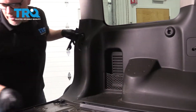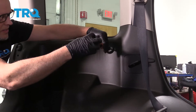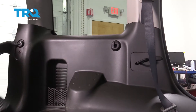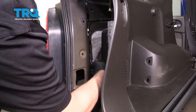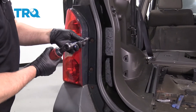There is a screw in there — take this screw out using a Phillips head screwdriver. We just need to move this panel out a little bit. With the panel like this, you can push down on the tab to access the connector and disconnect it. Then take these two screws out using a 10-millimeter socket.